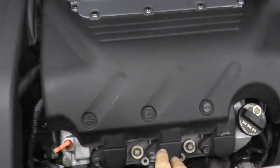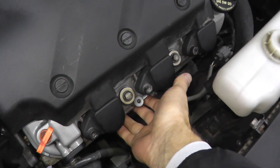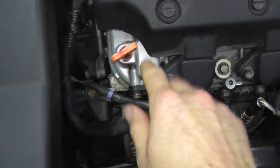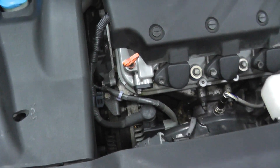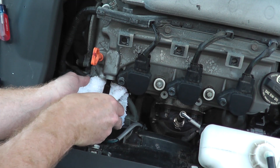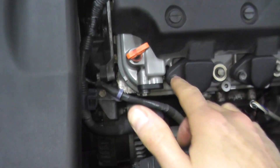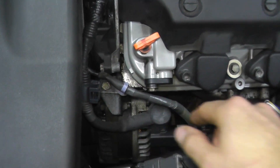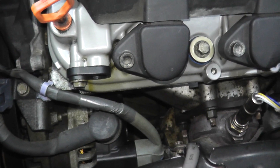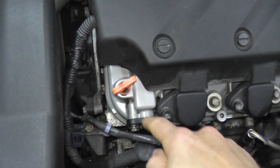Right here is the front valve cover. If I just place my hands underneath, the engine is hot right now but it's completely clean. Look right here — I completely overlooked this, maybe because I replaced this component just two years ago and did a video on how to test it. This is a PCV valve, and if you take a look right here I still have some oil residue — it's just slowly leaking to the bottom of the engine.